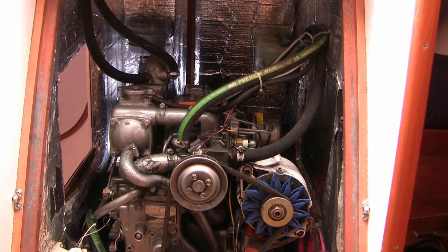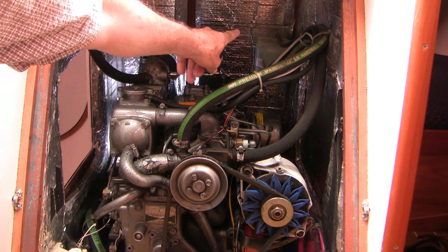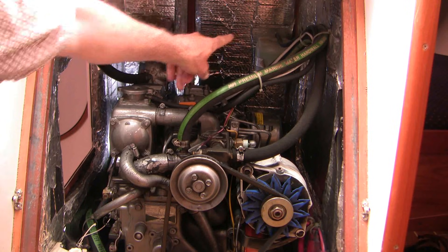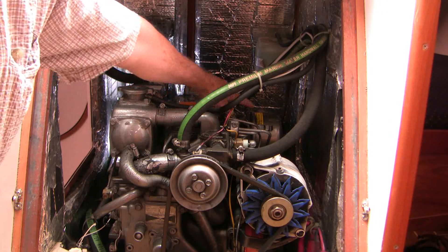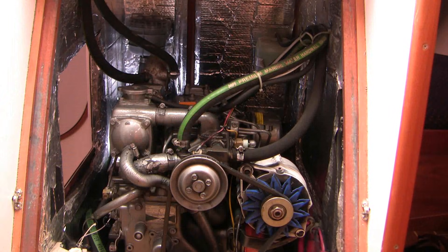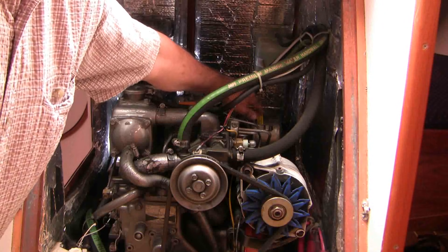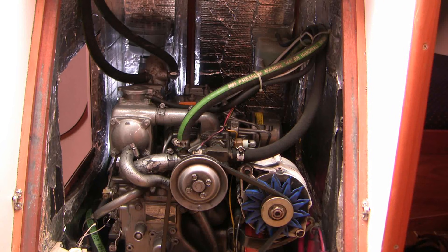What I find most intriguing about these engines is their elegant simplicity. Up here is your water reservoir and the fresh water coolant antifreeze reservoir — we put antifreeze in here and oil in here. And this here is the air filter. In a gasoline engine, controlling idle rate is all about controlling air, but in the diesel it's reversed: controlling idle is all about controlling fuel. Air is allowed free intake to what would have been the throttle body and carburetor — so there's no throttle body, no carburetor.